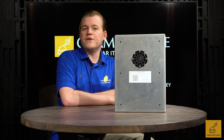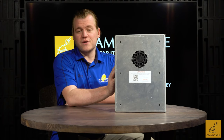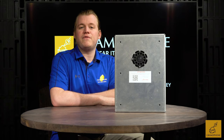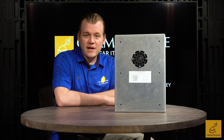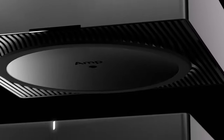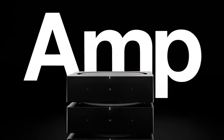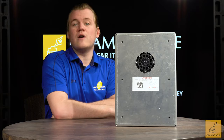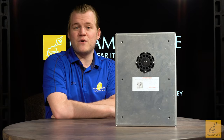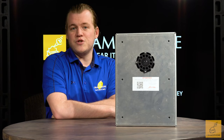These are not particularly difficult to drive — they recommend a power output of anywhere from 25 to 125 watts. These are 4 ohm speakers, so the only caveat is that you'll need an amplifier stable down into 4 ohm loads, but many popular streaming and distribution amps available today will handle that just fine. If I may throw a recommendation in, check out our video on the Sonos amplifier — those plus these make for a winning distributed audio combo. We here at Gramophone would be happy to help you come up with a design that integrates them in a very stylish manner.